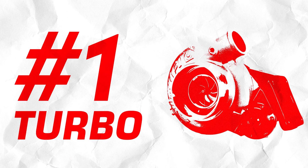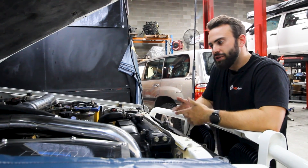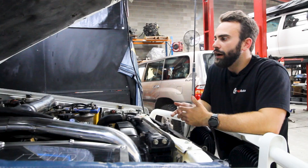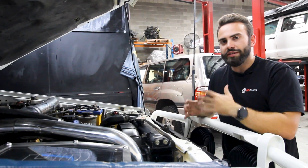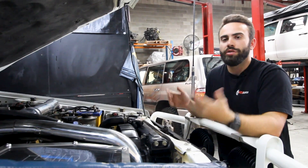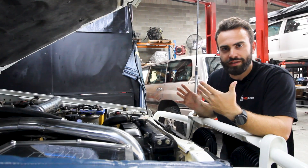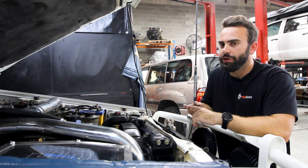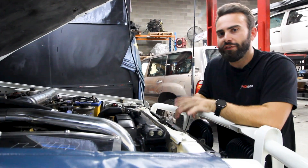Let's start with the turbo. On an FTE, the stock turbo is actually pretty good — in terms of a factory turbo they're extremely reliable. You can push them up to 18 psi and 200 horsepower. We've worked on hundreds of these and I've never had to replace one because it broke. That said, above that power level they just explode into pieces. So 200 horsepower at 18 psi — that's your limit on a stock turbo, and we're going to need to upgrade it.